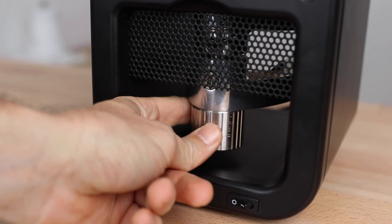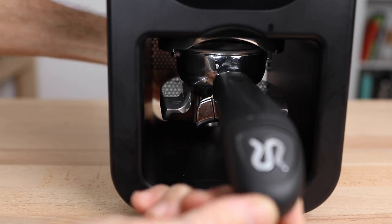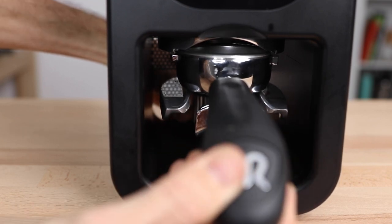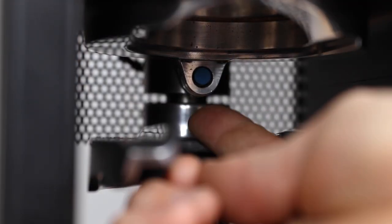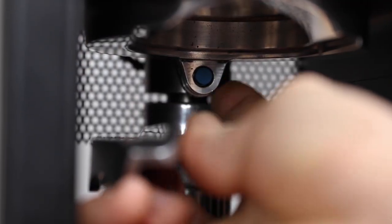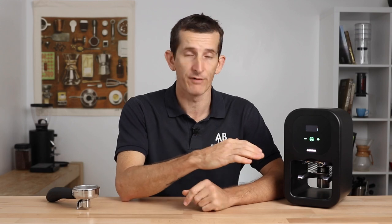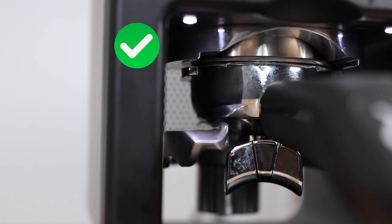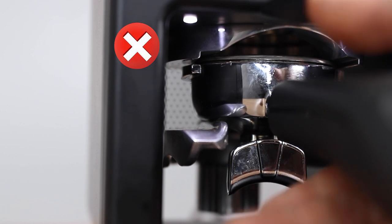Moving down to the tamping area of the Cube, you have height-adjustable forks that can quickly be moved up or down with the adjustment wheel accessed from the front or the back of the tamper. This will allow you to get a nice tight fit for your portafilter, which is also important to ensure a level tamp is achieved. There is also a second adjustment wheel that's not quite as obvious, where you can extend the magnetic sensor in or out that operates the tamp head at the back of the Cube. Depending on the make and shape of your portafilter, ideally you want that portafilter traveling all the way into the back so the filter basket is perfectly aligned with the tamp head, then hitting the sensor to begin operation — and not beginning too soon, as this will affect the level of your tamp.